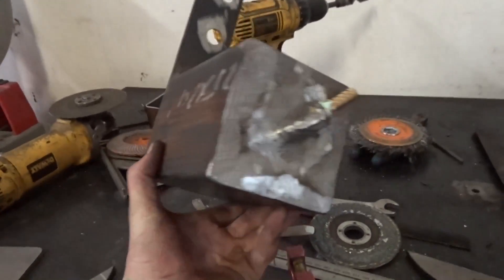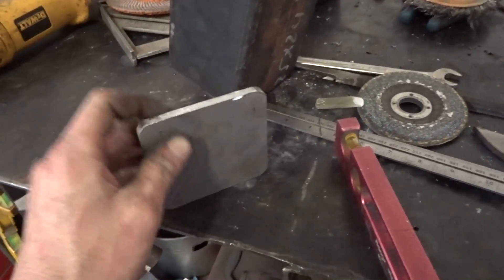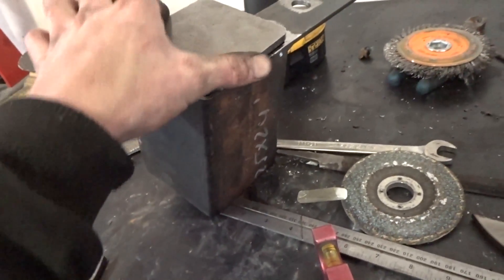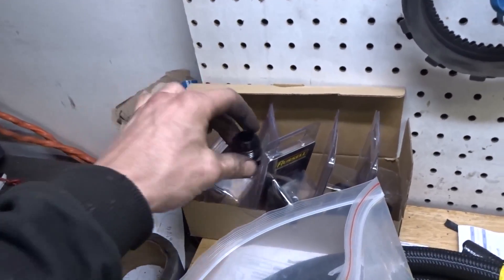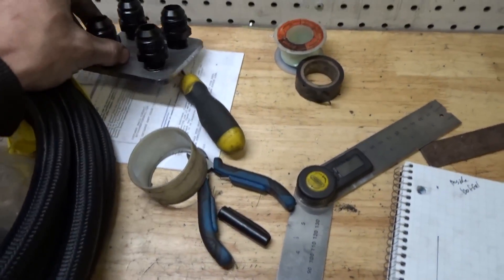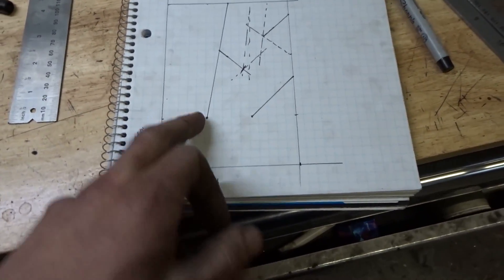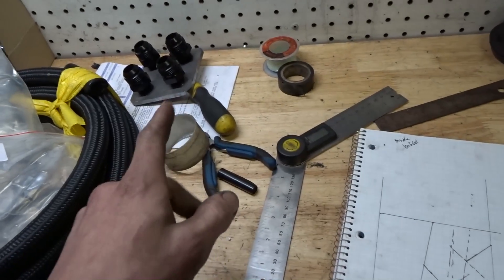Got this thing back out again and just started to build a top for it. I'm going to use a little bit thicker steel because I need enough material to get some threads in there. I'm going to tap in four of these on the top — half-inch MPT to 12AN. I got those all tapped in there. The top's ready to go now, so I'm just trying to figure out a design for my baffles.